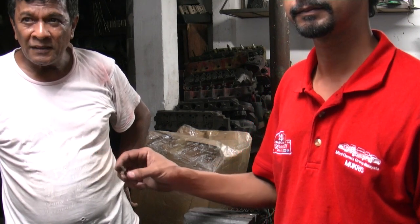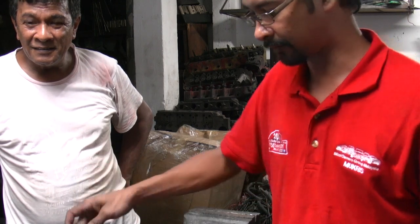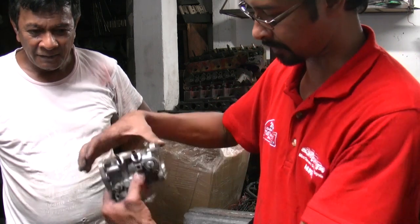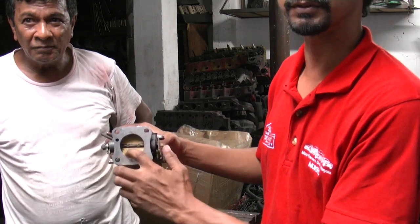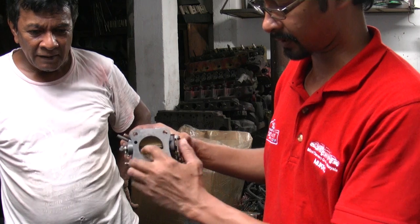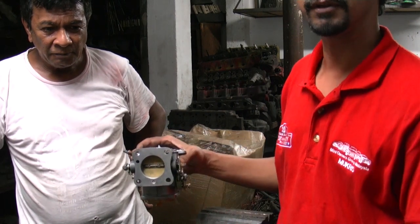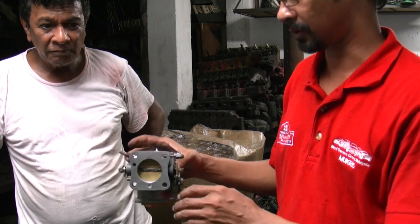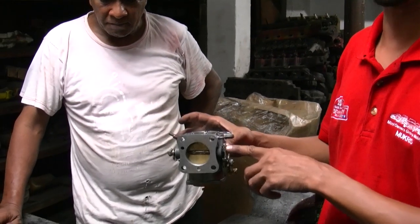Are most of the minis you do 1.3s? HIF-44 basically, it's got a bigger... This is where you calculate the diameter of the hole. So when you get this, this is HIF-44, so it's right. Got more airflow for the 1.3. So usually for a bit better performance, you would use a HIF-44.